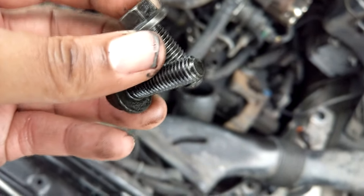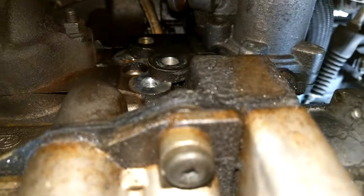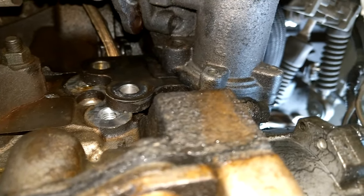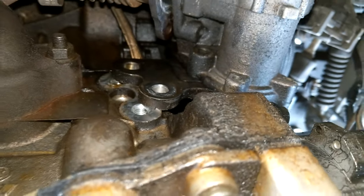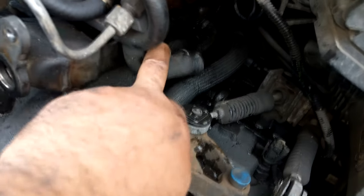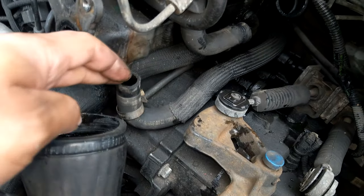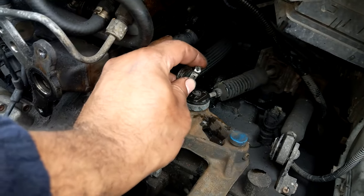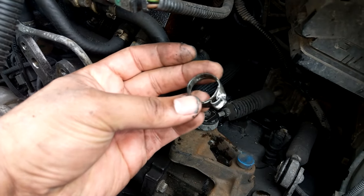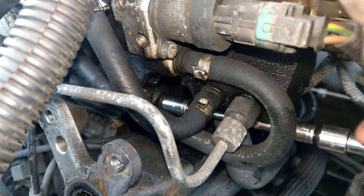On the front of the cooler was a thin shim, and then there are two larger bolts holding the cooler on at the back. The cooler is also held on with two coolant pipes which need removing. I lost around about 100ml of coolant — hardly anything at all. It would have been much worse if I hadn't drained the cooling system first. One of my hose clamps was an Oetiker clamp, so that needed replacing.